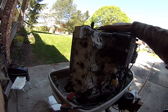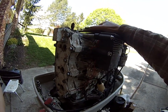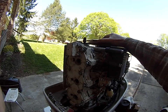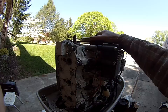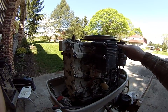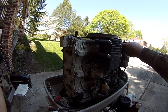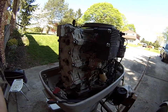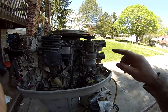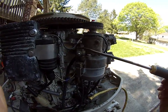When the top plug sparks, you are at 32 degrees supposedly. So you rock the flywheel a little bit to center exactly where the spark is, and then you press on the distributor belt. Each time you press on the belt you should get a spark. If the spark is not at 32 degrees, this is the distributor link and it is used to adjust it.